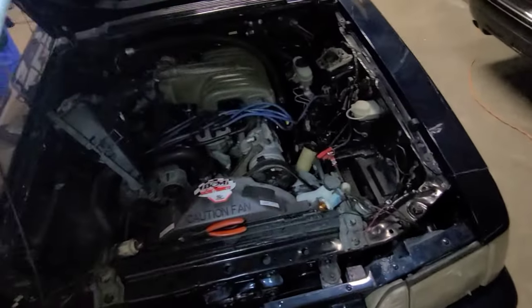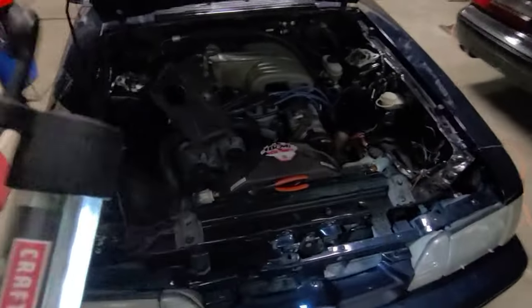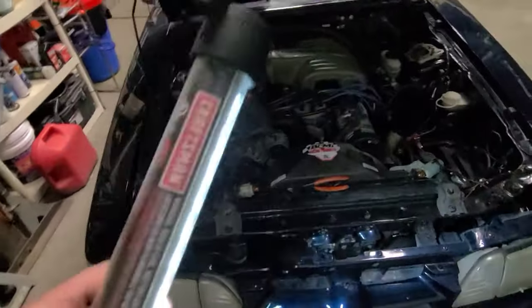Anyway, what I do know is that the entire thing has been taped up. Somebody rebuilt the entire harness. And I had it in my hands and I probably shouldn't have. This was all tucked up. None of this was existing when I got the car. So I ran it all and it's installed properly. The grounds were where they were at, nice and clean, good grounds everywhere. The issue was that I would turn on my parking lights and one blinker would work, one wouldn't. And it's all related to the front.